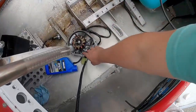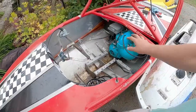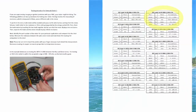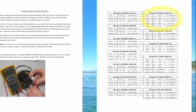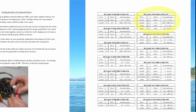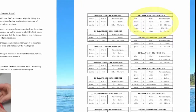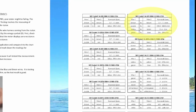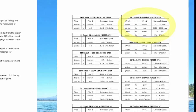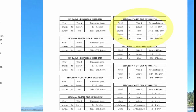First thing I'm going to check is the stator, because we've always had troubles with the stators on these 1100s. I'll put up the specs on screen. I did all the ohms testing on my stator and it tested out good, but I don't trust that — maybe the pickup is covered in metallic particles or something. I have a brand new stator that I put on here and it didn't make any difference whatsoever, so I don't think the stator is what's wrong with it.